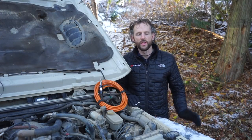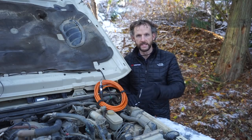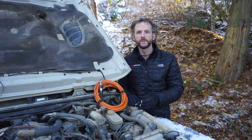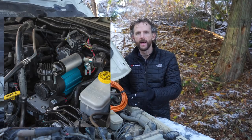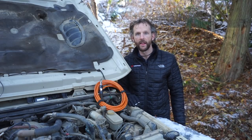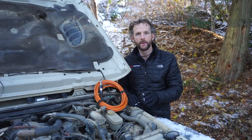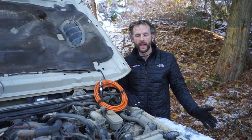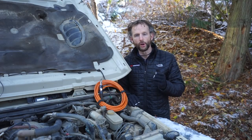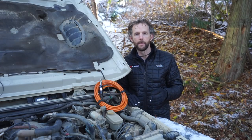When it comes to your tyres, the first thing I recommend everybody have in their vehicle is a quality air compressor. Here I've got the little ARB single compressor — I've talked at length about why I have the single and not the dual, so you can check out my other video about that. The reason I really recommend an air compressor is not only so you can deal with flat tyres, but more so that you can confidently air down your tyres knowing that you can air them back up again later.